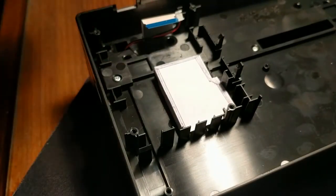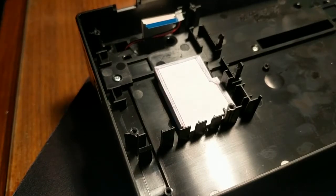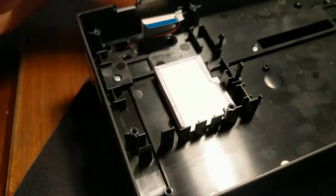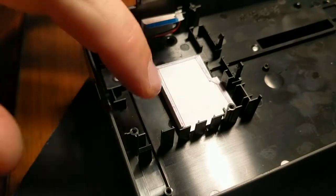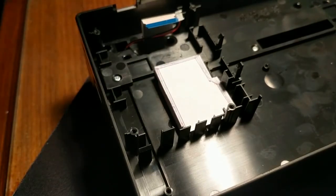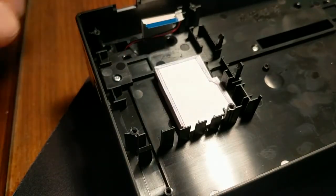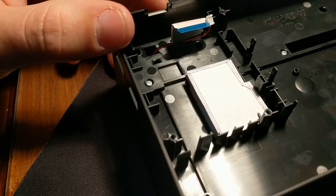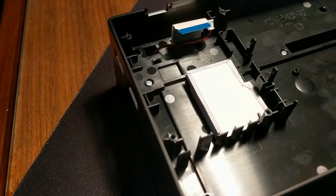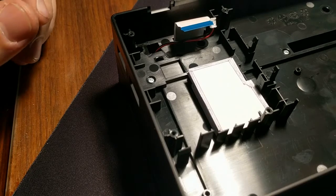So what I need to do is make a mock-up. I'll run the system with Breath of the Wild, FastRMX, Minecraft — run it docked for about 20 minutes, leave my temperature probe in there, and do some readings. Then drop in my mock-up, put everything back together, do my readings, and see if there's any change. If there is and it's worthwhile, I will let you guys know in an update video and probably put some of these things up for sale.